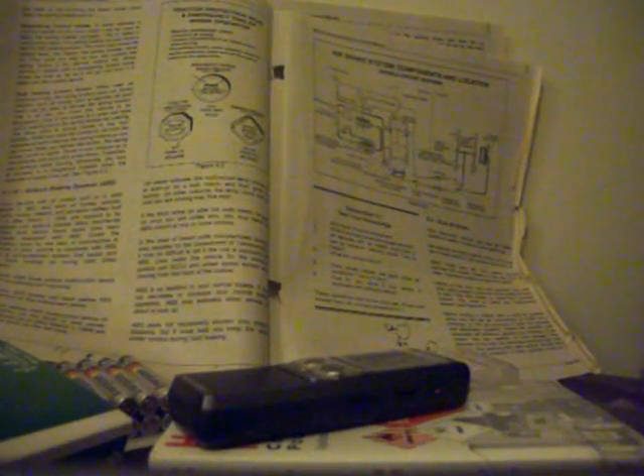Anti-lock braking systems (ABS): Truck tractors with air brakes built on or after March 1, 1997, and other air brake vehicles — trucks, buses, trailers, and converter dollies — built on or after March 1, 1998, are required to be equipped with anti-lock brakes. Many commercial vehicles built before these dates have been voluntarily equipped with ABS. Check the certification label for the date of manufacture to determine if your vehicle is equipped with ABS.